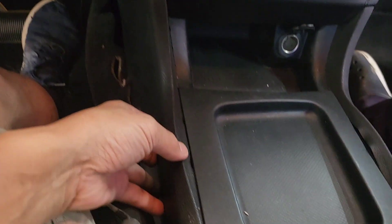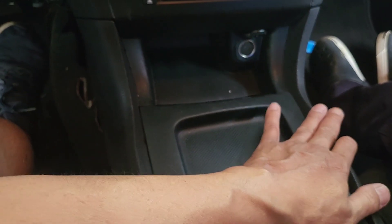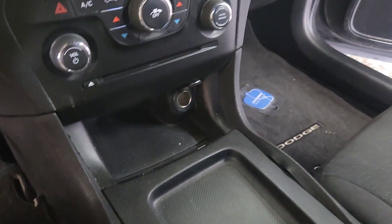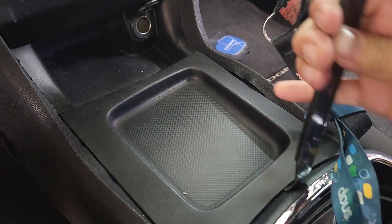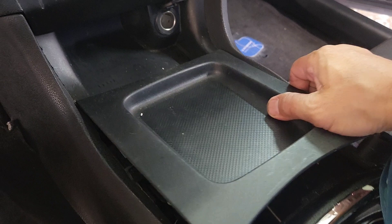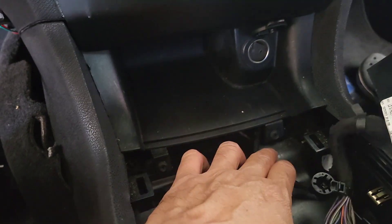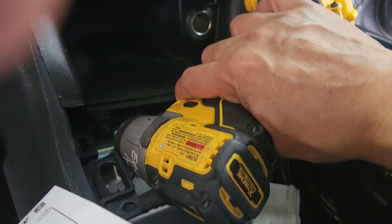As you can see right here, since it's a police car they have to pull all this other stuff and devices off, so they kind of damaged this part. Today I'm going to show you how to remove it. First off, I'm going to try to remove this clip right here — whatever you call that thing. They already pulled it out, so it's pretty easy. Put it up, and you have to take these two Phillips screws out. I'm going to remove the two Phillips right here.